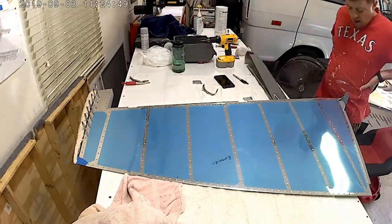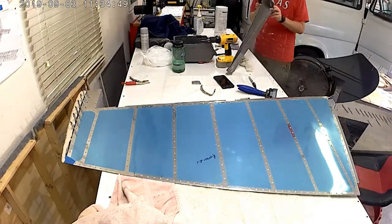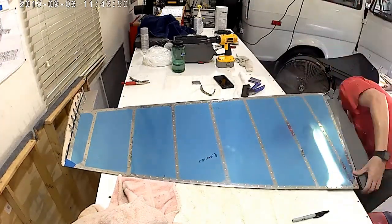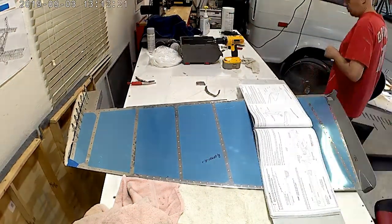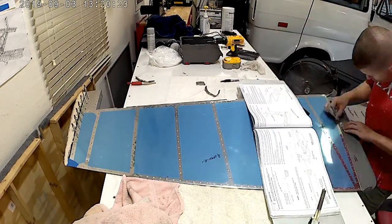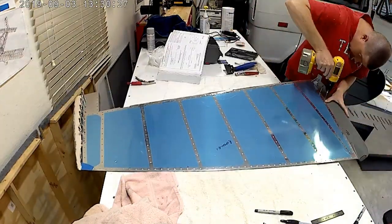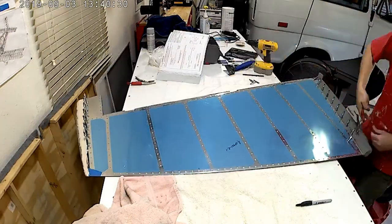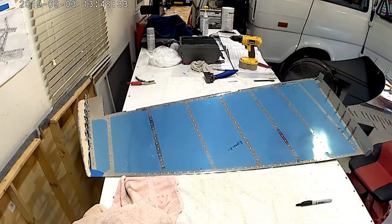You can see the bottom rudder fairing there — it's already been trimmed for the center line. When they come to you there are essentially two shells that have been glued together, and those center lines really need to be ground down. It took me a little while to figure out that that was just part of the manufacturing process, because the plans do not say anywhere that that is indeed what you need to do.